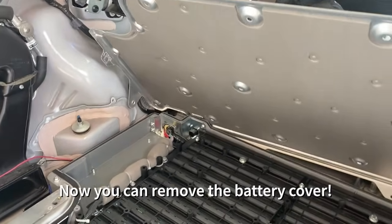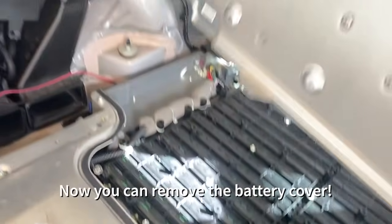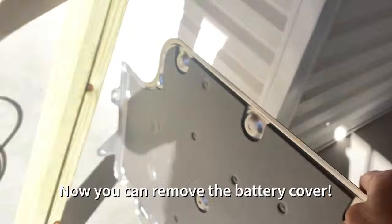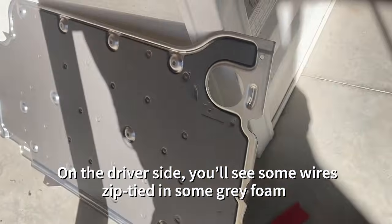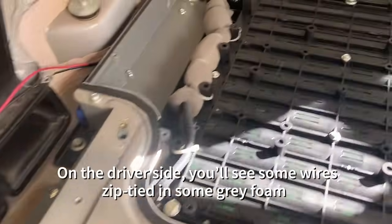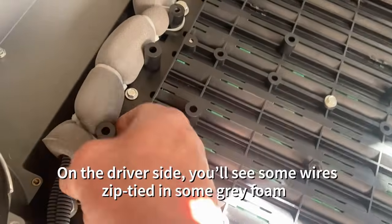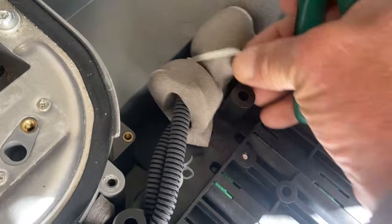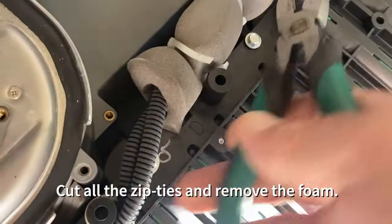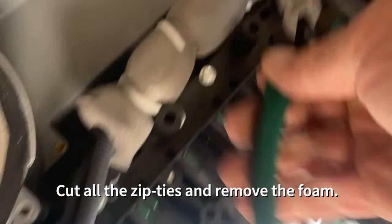Now you can remove the battery cover and here we can see the battery. Make sure that orange disconnect plug is out. On the years before 2009, they had a charging system in place inside the battery, and for whatever reason they didn't include it in the 2009. It was over on the driver's side — you can see this kind of empty area with gray plastic, and this is where we're going to tap into. They left the wires for the charging system there, so we're going to tap into those and put in our own charger.